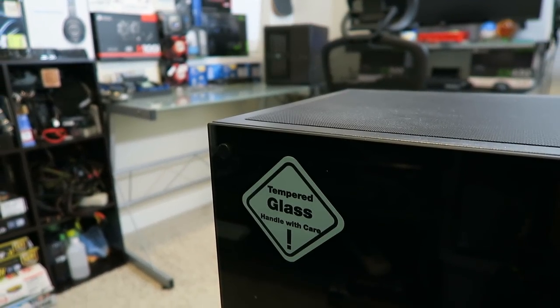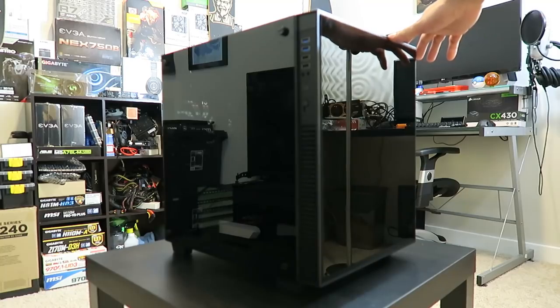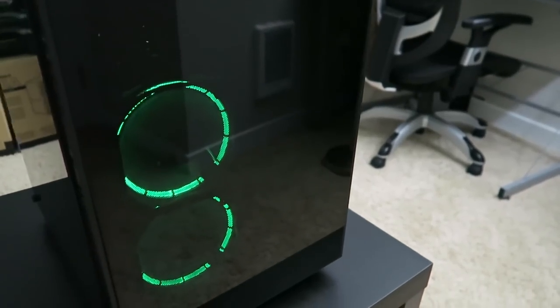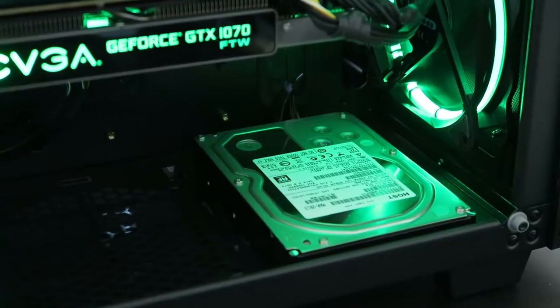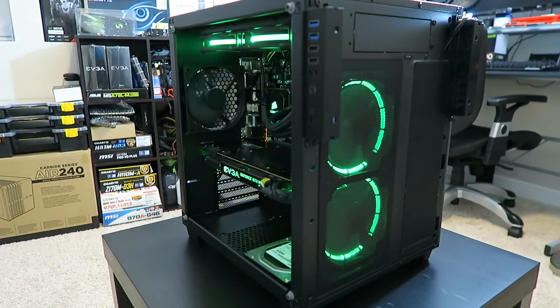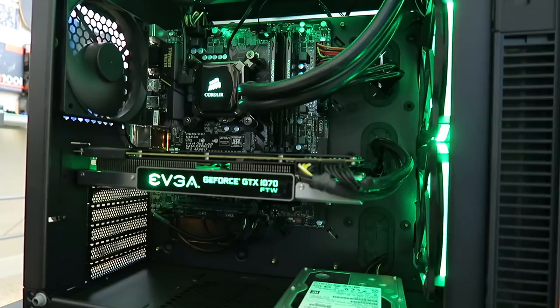Here it is all done. Inside the case you can see my third 3.5-inch drive, which I had to use a Molex-to-SATA cable to power. I mounted the front fans on the inside of the case since I didn't want to starve the fans of air by putting them right up against the front tempered glass panel — this location made the most sense to utilize the front magnetic filters properly. Note that I'm using all three grommet holes for the most direct cabling path and to reduce cable length in the primary chamber.